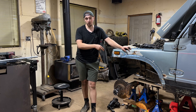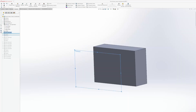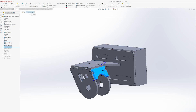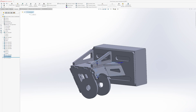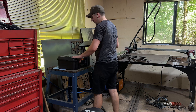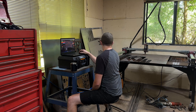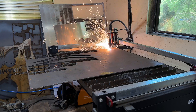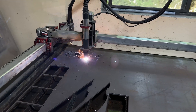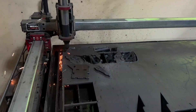It's going to give us five inches of bump and I think we've placed our link mounts just to narrowly avoid the engine mount inside the engine bay. After using the PVC I've gained some confidence in these link mounts. I can start designing it in SolidWorks for 3D design and then import the flat structures into SheetCam for the tool pathing on the CNC plasma table.